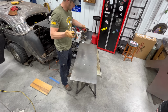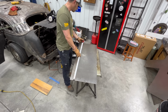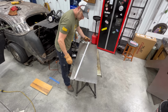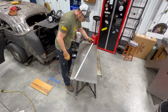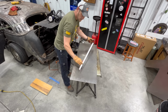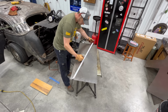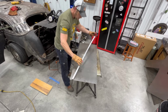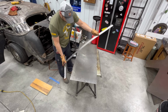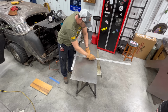So this is an old carpentry trick, but you know, we are at about 42 1/4 in width. Being lazy, if you don't want to do that math, just take your tape and turn it until you get to an even number over here that's easy to divide. So in this case, I'm just going to go till I'm at 44, and then here's 22 right in the middle. That'll be my center for that. And then I will make my line like such, there, right?